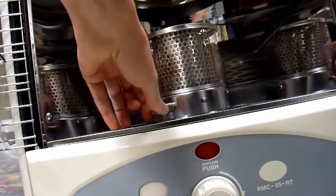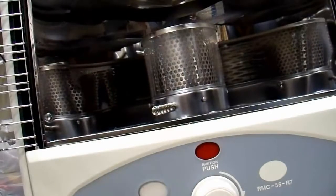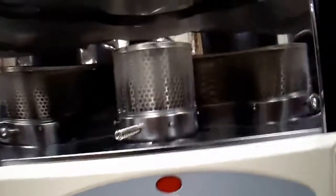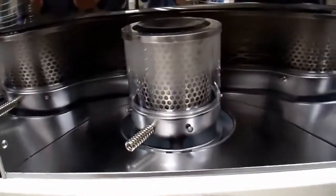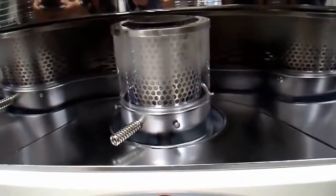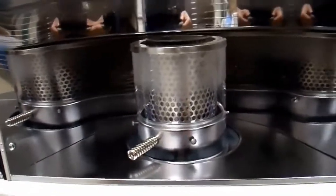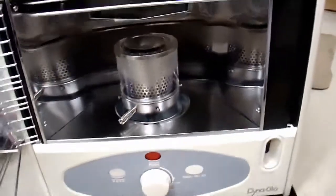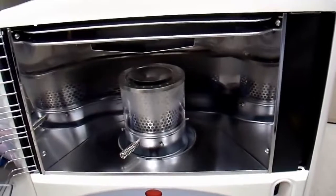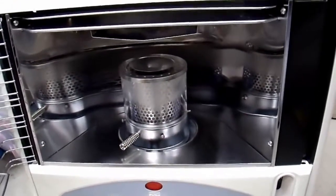Yeah, that went immediately. So I don't know if the battery ignition is going to be very reliable or not, but it's definitely burning now. I have the wick up all the way, and I'm just going to let this get going and adjust the flame until it's burning nice. Let the whole heater get nice and hot, and hopefully burn off all the oils that are on it. Put it out, let it cool down, haul it inside, and then we'll see how it works inside.